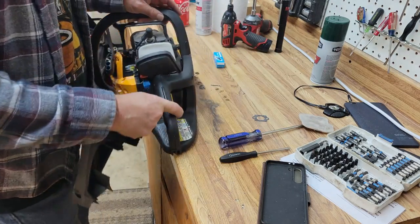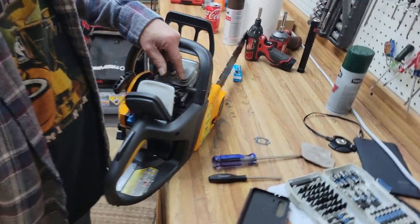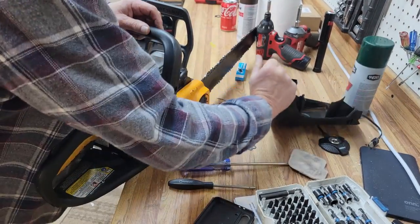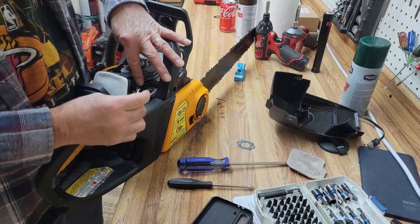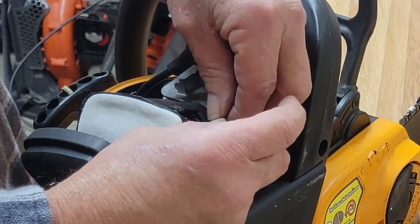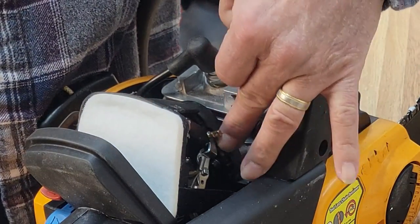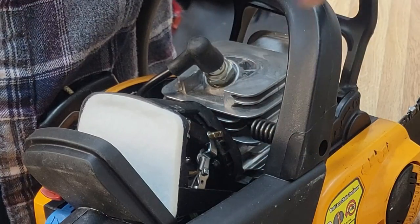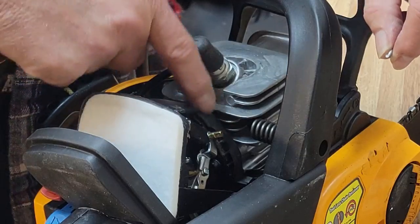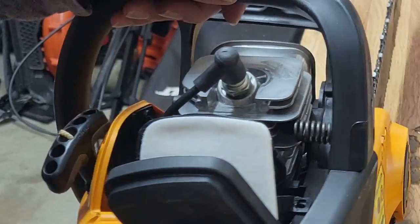See what I was saying before? If you'd had the little steel bar, let me pull you around here. If we were carrying the backing plate that required this little steel bar, and this is the backing plate here. It's actually on the front side of the carburetor. But if it were here, it would be hitting right here. And you'll see people do this, and they'll try to cut this and change things around when it's not necessary. All you need to do is change out the backing plate for one that doesn't require that bar.